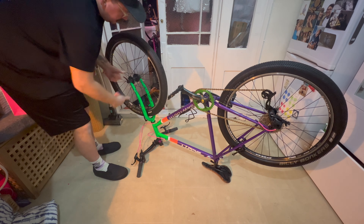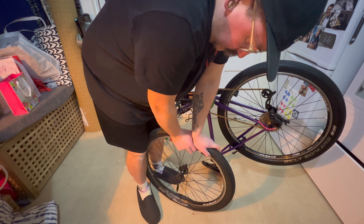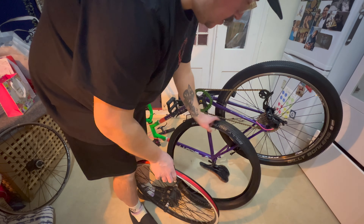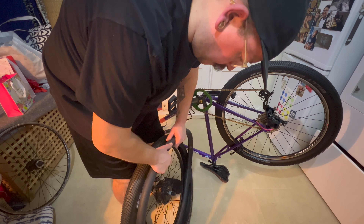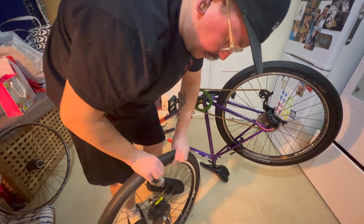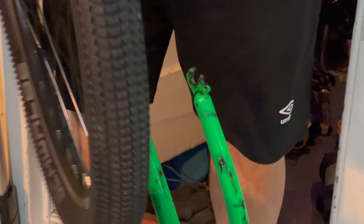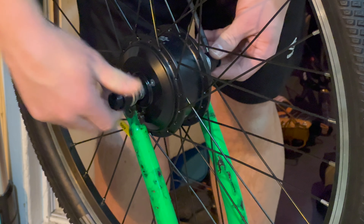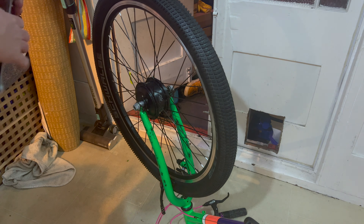First I took the wheel off the front of the bike. I wanted to keep the same tyre, so I moved it onto the Switch wheel. The Switch kit will work on any bike — when you order your wheel you have to tell them the exact measurements of your wheel, the dropouts on your fork, and the width of your fork, and they'll send you a wheel for that frame. In my case, when I put it on, the motor hit the fork very slightly, so I added an extra spacer and then it ran nice and freely.